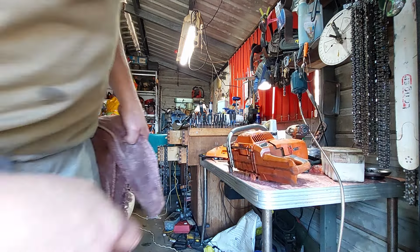Yeah, it's still on there, so I'm not sure what's going on here. There's some oil in there. Fair bit, actually. So I'll have a look. But when you do a palm tree, or trees with very acid or alkaline sap, clean your chainsaw out really well with WD-40, Inox, or some type of oil-based stuff to neutralise the acid, otherwise it'll screw it up. I'd say that's what's happened to this thing, but who knows.